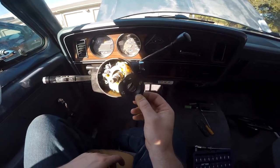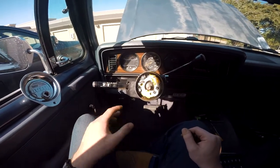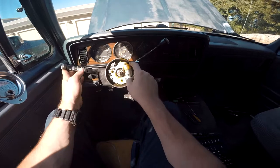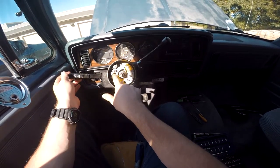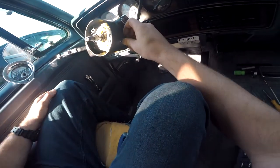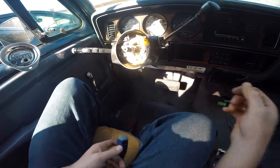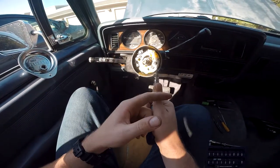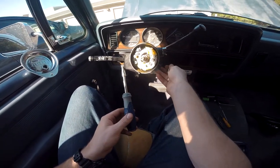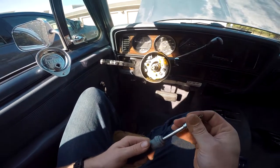Since your steering wheel and locking plate are now out of the way, I'm going to show you how to pull out your blinker switch. There are a total of five screws you have to remove: this one, this one, that one, and this one. And if you're like me and forget every time — you also need to remove this guy right here, your hazard switch. That's a little baby screw, so everything else will be a number-two Phillips and I recommend a number-one size for the hazard switch screw. Let's knock out the hazard switch first.